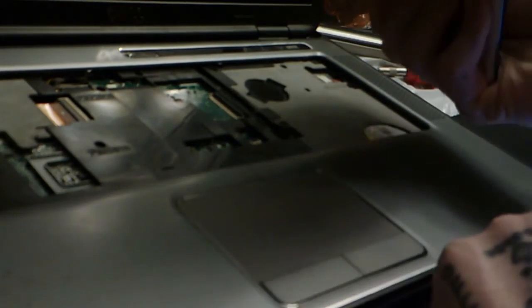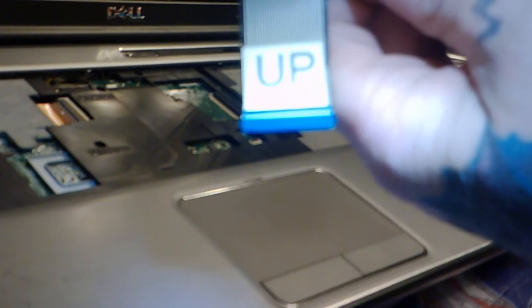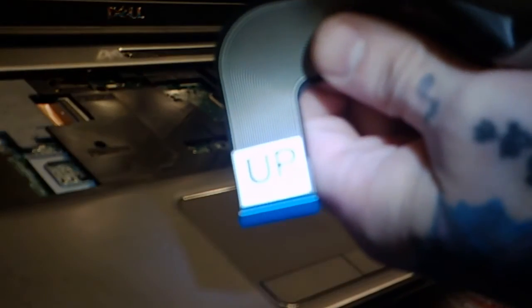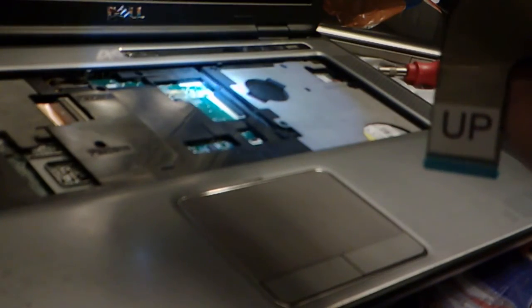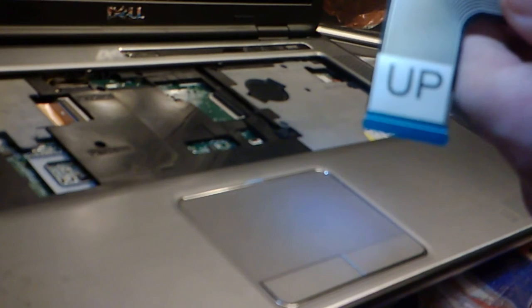This is the part that might make you tear your hair out. On any of these parts that have a ribbon cable, you'll see a white line — that line is supposed to be lined up right at the bottom of the connector. That's as far as you put it in. If you put it in and you can't see that white line anymore, you have it wedged in too far. Also, on the sides of the ribbon cable connectors there are little cutouts where the notches fit in perfectly, which guides you exactly how far to insert it.